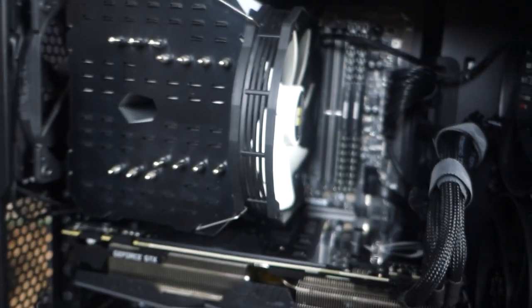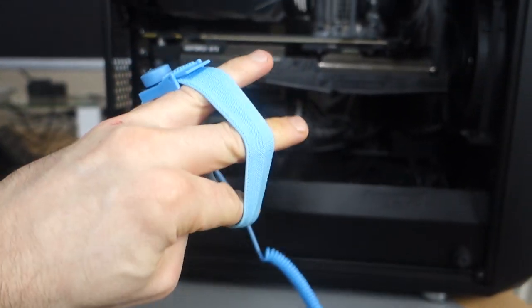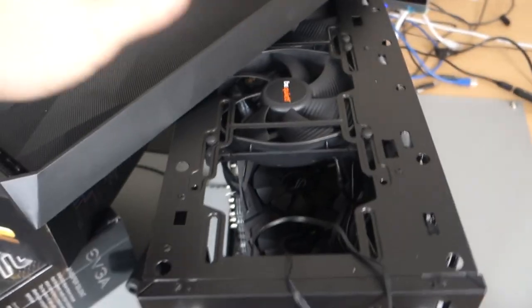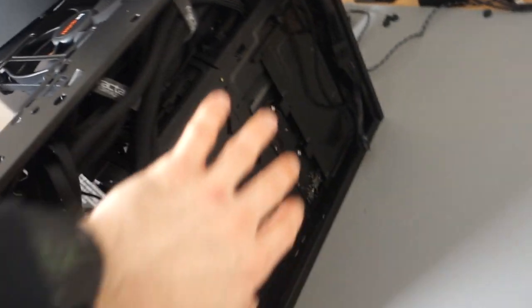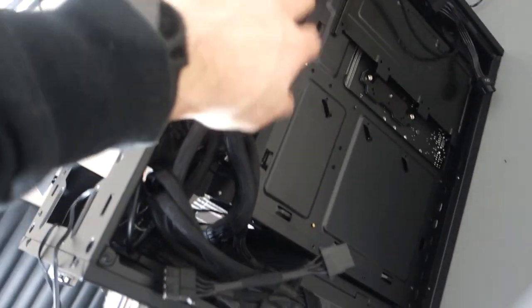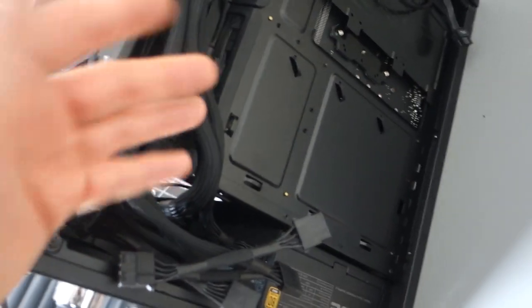So when you're doing this, make sure you use an anti-static band if you can. This is an anti-static mat and you can also attach it to the metal part of your PC. I've taken off the front of my case and the side — that was very easy. You can see a lot of the thicker motherboard power cables have been tidied up at the side. I'll start by pulling the cables out of the PSU first, so I have more freedom when disconnecting them from the board.